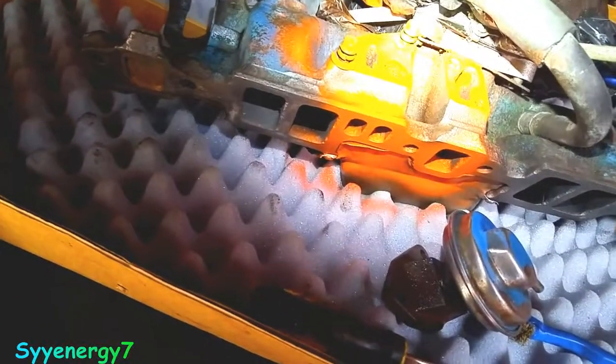I know the inspection guy would lift this valve up, and you had to take your intake manifold off, and it's kind of a pain in the ass, to tell the truth, but you've got to knock all this carbon out of here, get new gaskets and stuff, and also watch for a distributor gasket. I don't think there was a distributor gasket in this damn thing.